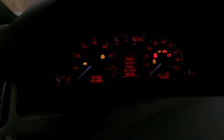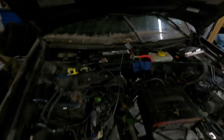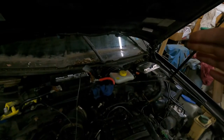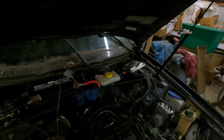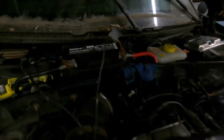Now that I've removed the transmission controller, since I already flashed the car, we get 'press the clutch pedal to start engine.' I want to reflash it just to make sure there wasn't anything hanging in there that would have been pushed over from that controller. Before we flash, you want to hook up your battery to some consistent power — just a simple battery charger placed on over the connectors. That's going to make sure you don't have any power dips. If it dips below 12 volts, the ECU is going to turn off and you'll mess stuff up. It takes like five minutes — slap one of these on there and you won't have to worry about it.